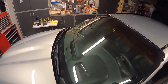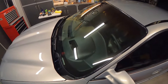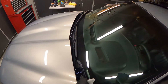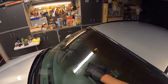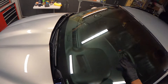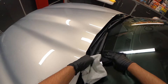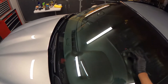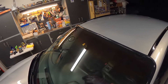You have one to five minutes to get it wiped off. It's starting to tack up — the last section I did at four and a half minutes and I'm going to let this one go the full five minutes to see. About four to four and a half minutes seems to be the right window. It has a real long wipe-off window and once you do wipe it off, it comes off relatively easy — just don't expect it to be very slick. PNS View is one I really do recommend trying out — that's a fantastic coating.